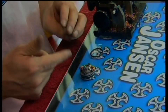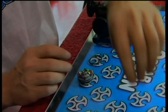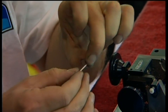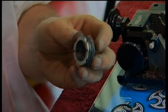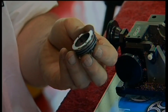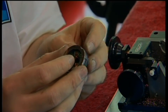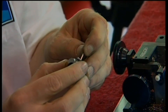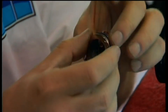Then we go for the brushes. Normally the only thing you have to do with the V2 is skim the commutator, but not a lot of people know how to work with the brushes, so I'd like to show the tricks. The first thing you need to do is make the wire straight — this is very important because the wire has to go through the spring and come out here. You just put it through straight and guide it to the top of your finger, and while you push here you guide the brush in. You see it goes very easy.